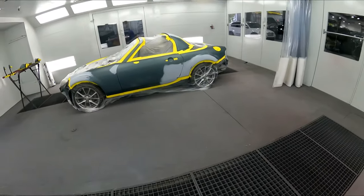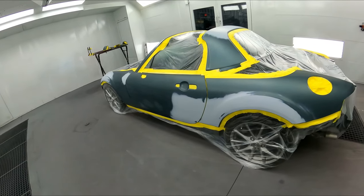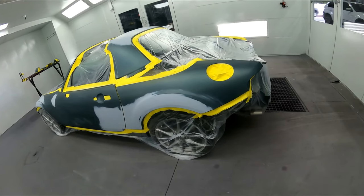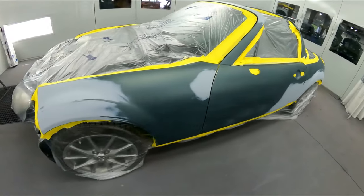All right, we got it all bagged and ready to go. It's all wiped down, and we blocked it with the 320 block with the Festool. Then we hit it with the 400 DA, and then we went around it and buzzed it with the 600 DA to refine the scratch. So it's all ready to go. We've wiped it. We've just got to tack it.